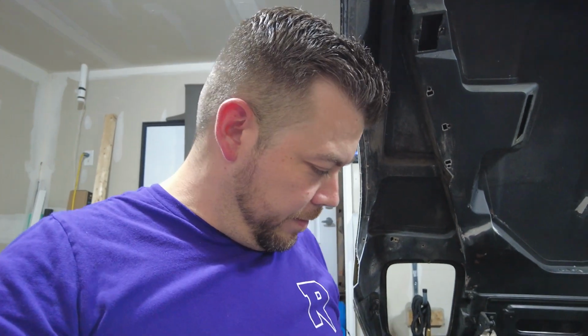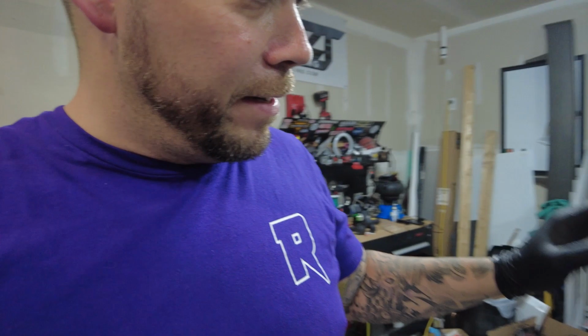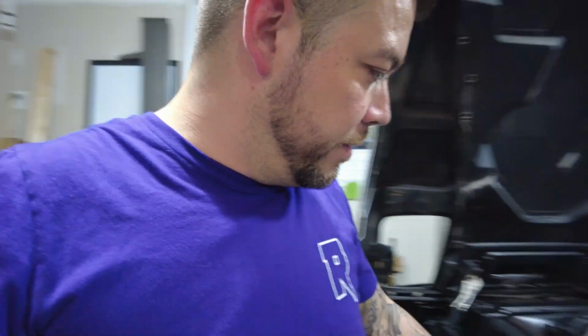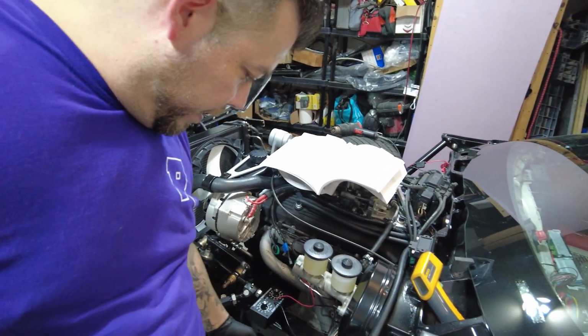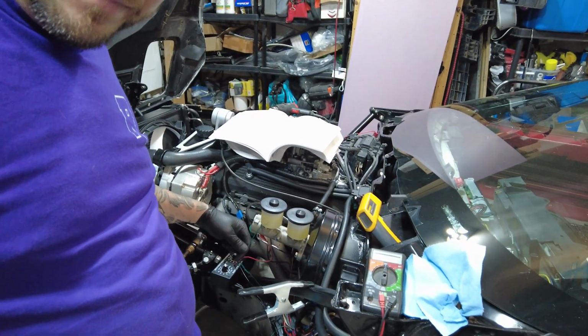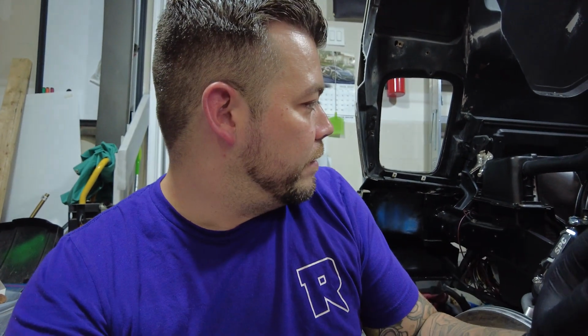So now I just need to verify what 160 degrees Celsius means in resistance. I don't know if this is even accurate, but this thing says 10, whatever that is. So that's huge, that's awesome. So what I'm going to do now is, off camera, I will switch the oil pressure sensor line with the dark green wire. I need to figure out where this went because it seems to have disappeared somewhere. I don't really know where I put it, but we're going to get that. I'm going to restart this wiring. We'll get that going, so that's fine. Also, the coolant fan is not coming on when it gets up to temperature, so definitely need to figure that out as well.